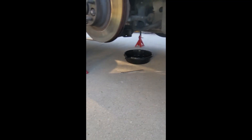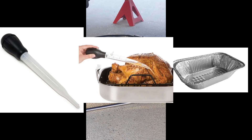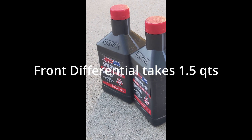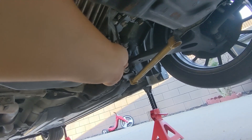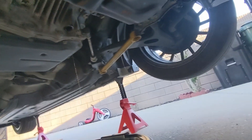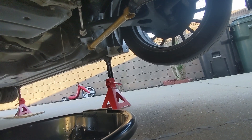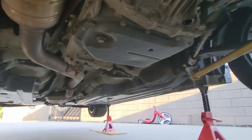You're also going to need some sort of drip pan — whatever you have, it's got to catch that fluid. If I'm reading online, the front differential takes about one and a half quarts, so I bought two quarts — that should do it. So we're going to pull off the check plug to see how much overfill there is. Oh, there's a crush washer in there — that's something I didn't buy, so I'm going to be reusing it, but if you're going to do this you'll probably want to have that crush washer.